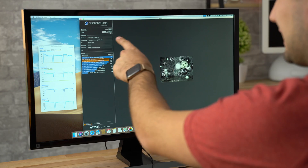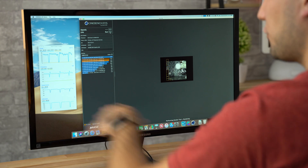This exact processor in a Windows computer, even with a stock cooler, should run at least 3.8 gigahertz. Under full load, even though it's rated at 4.6 gigahertz, it can only hit that using just one core. If you're maxing out all cores — doing video editing or exporting photos from Lightroom, which now uses all cores — you're not going to get that. The max you can realistically get is 4.3 gigahertz. I just saw 3.28 — that's a little bit disappointing.